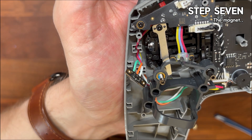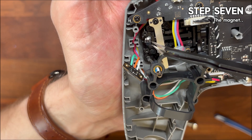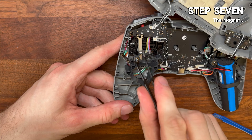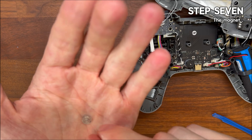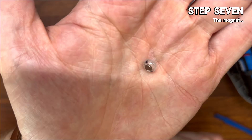Step seven is to mark the magnet and remove it. Before we do anything else, take your black marker and draw a little line on top of the transparent casing that holds the magnet — that's going to help when we're putting it back together later. Use your tweezers to gently pull the whole casing out; it should come out sideways first and then up. Now have a look at the magnet itself — you'll notice that it isn't a perfect circle, it's got a flat edge at the bottom. Make a second mark with your black marker pen on the visible side of the magnet. This is really important because we're going to flip the magnet 180 degrees and we need to know which side was originally facing outward.